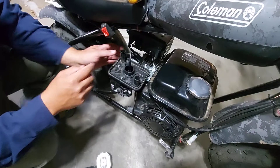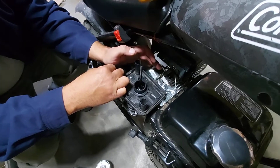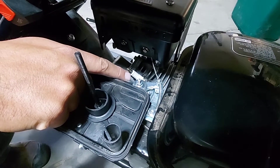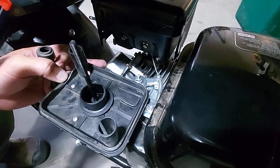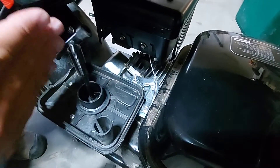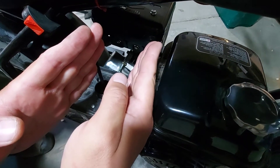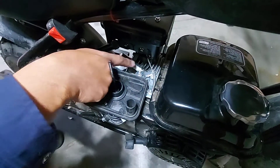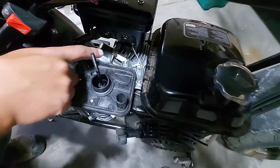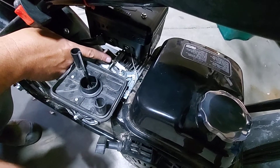If it hydro locks, what you're going to have to do is remove the spark plug wire and actually take the spark plug out. What that does is open a hole right into your engine. You've got those pistons in there and you had a vacuum before where it had all that oil stuck inside — it could go down but it couldn't go back up. Where it would come out is right in that hole. So you pull on the starter cable probably about 60, 70 times and oil is going to shoot out this hole all over the place.